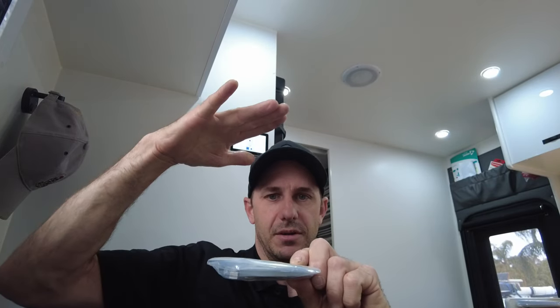100%. I guarantee you guys, if you put one of these on your water tank, you're going to see unparalleled tank levels. You're going to know exactly where you are because this knows the exact height of your water level. It knows the distance between that surface and the top of the water. It's very simple. So I try and tell people to zero off the bottom of your tank. The minute you start seeing your water spit and spat, getting air, sucking air, stop it, wait for a few seconds, go up to your screen and zero off that tank, whichever, obviously not LPG, whatever water tank's associated with that.